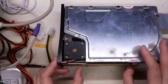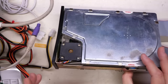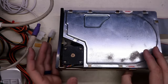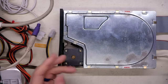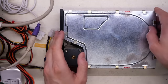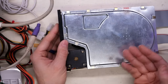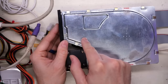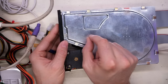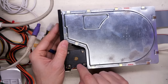These stepper motors are just like the stepper motors on your 3D printer today — very similar. Sometimes these get gummed up, and a little bit of oil in the bearing can kind of rejuvenate them a little bit, though it's not a good long-term solution. It'd theoretically be possible to replace the stepper if you could find the exact model. The stepper ones seem to be a little bit less reliable than the later voice coil ones, which is the way modern hard drives work. Voice coils use electromagnets with neodymium to position the head — much faster, much more precise. It was around the eighties when hard drives started moving to voice coils over steppers.